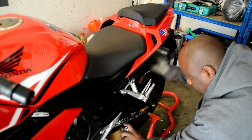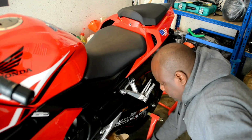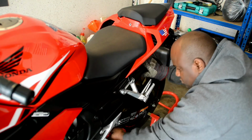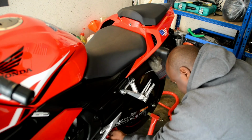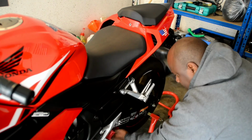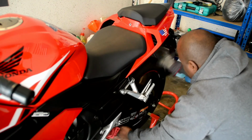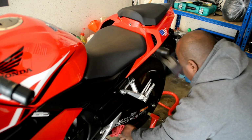And I've done this every 500 kilometers. Oh, look at that fat coming up. I've done this every 500 kilometers, almost without fail, with no real problems. It dripped all over. And this you want to do carefully because you don't want your hand to get bound up inside there. But I like to just take it and go all over there. I always sacrifice one nice terry cloth for it, which they don't cost that much, and you do it every 500 kilometers, it's not so bad. I like to have a nice clean chain, especially if I'm putting it up for the winter.